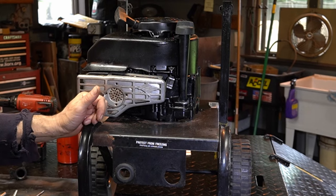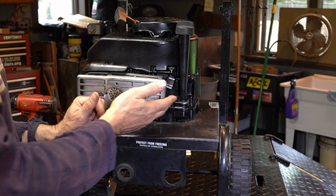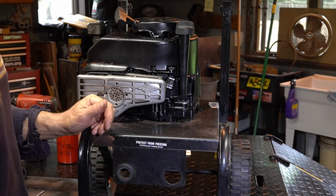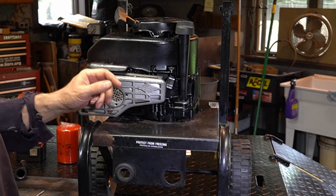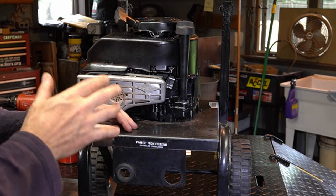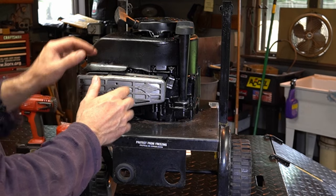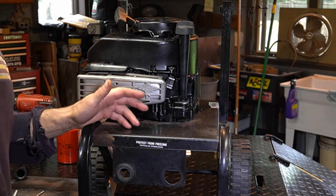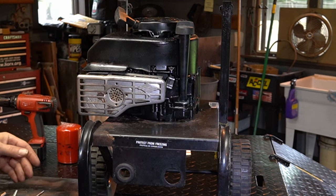Some of that dirt might have gone into the motor - probably not all that much but enough stayed in this area. By putting a little bit of RTV on that, that might solve your problem if you have a leaky dipstick that's just not fitting tight. Some of these, when they're original, are so tight that I can spin the motor over with the dipstick just hanging there and it won't leak. Others peel oil all over the place.